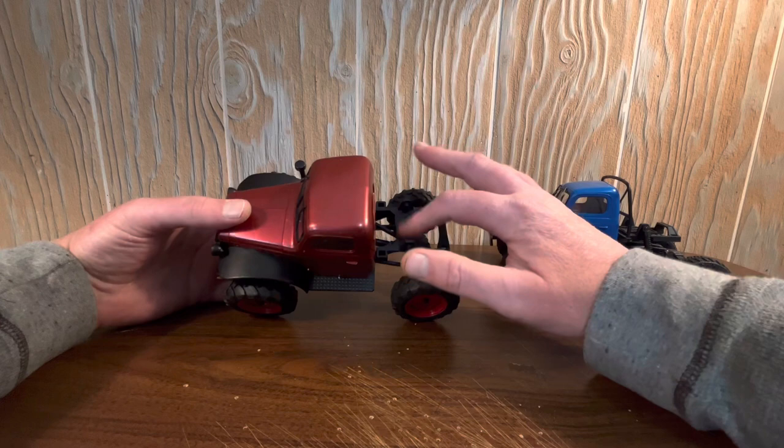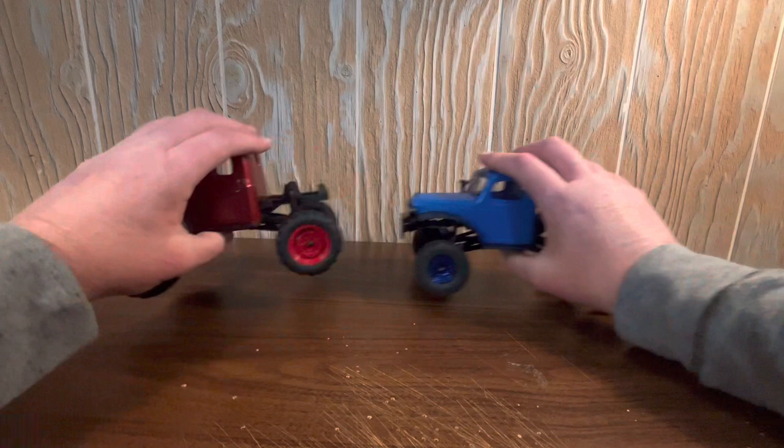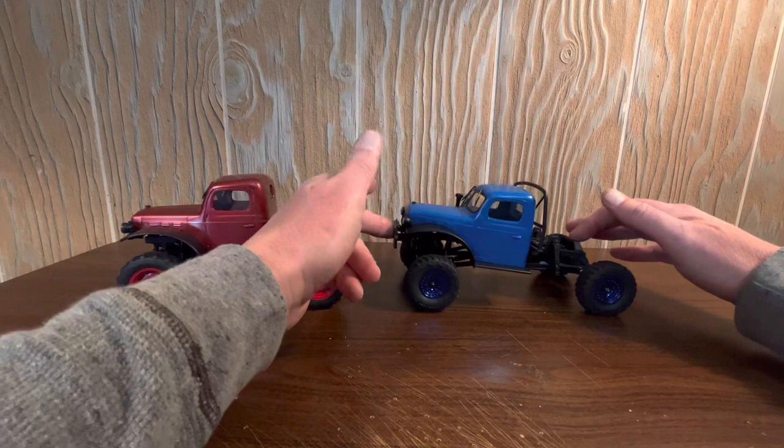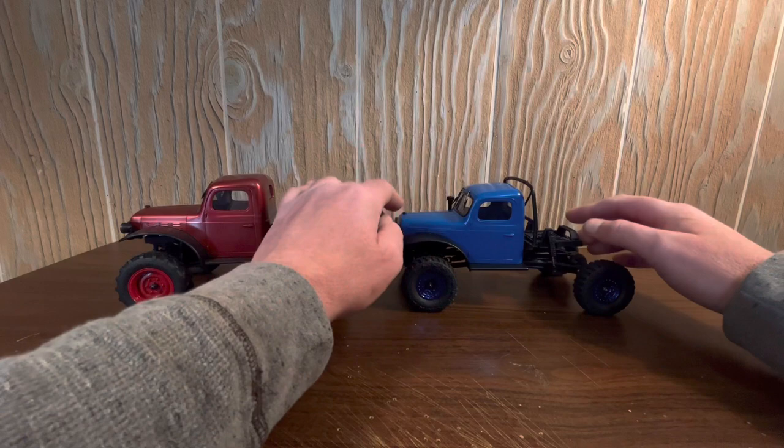I was going to go here, but on this one, I know that's kind of where a fifth wheel would normally hook up, in between your rear axle. But it just was too much rearward weight on this, so I wanted to move the trailer to where it would hook up a little more toward the cab, just to position that weight a little bit up front.